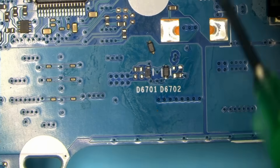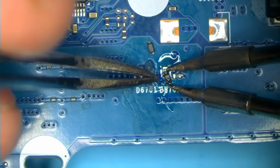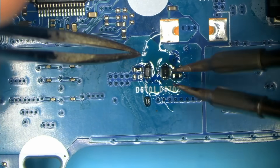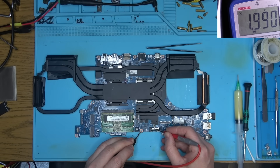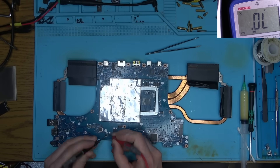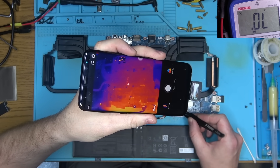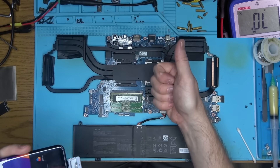The reason may be the difference between the two diodes — they both need to be the same type. Since I don't have the original kind, I'll make them both the same by replacing the good diode with another one as well. The voltage drop is reading the same on the motherboard pins as well as on the diodes themselves, indicating they are the same type. So let's try to power the laptop with the battery again. And there — we got POSTs. It's finally powered with the battery!